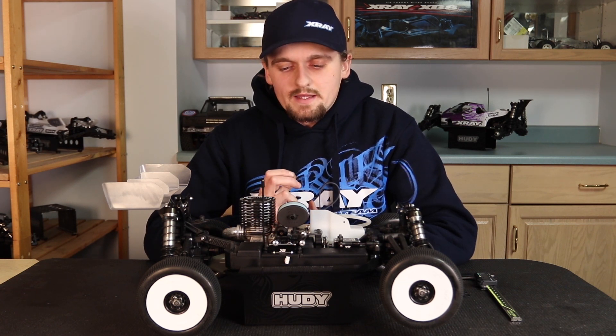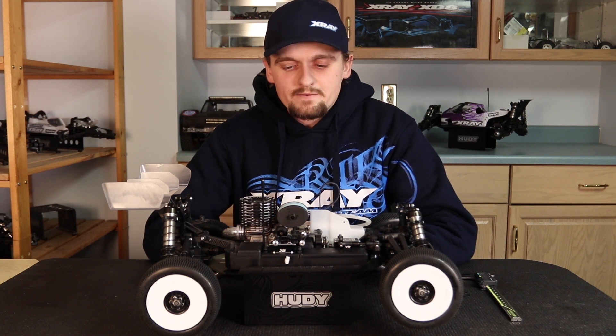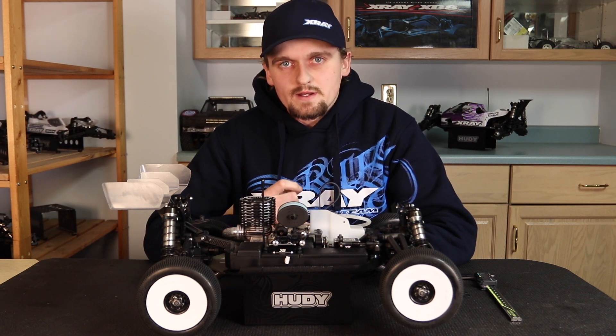But if you have it opening any further than the venturi, you're just wasting fuel and making your power band very abrupt and hard to drive, so it really doesn't benefit you to run it past the venturi opening. Oftentimes I'll actually have it opening less, so it has better fuel mileage and a better power band for whatever track I'm running on.